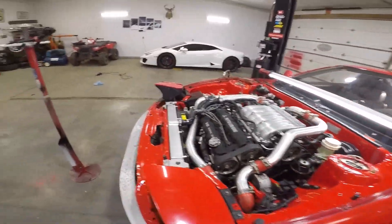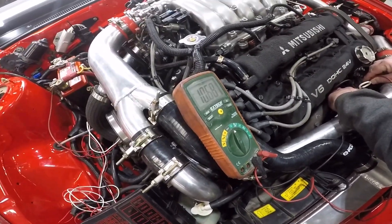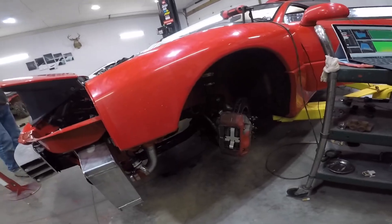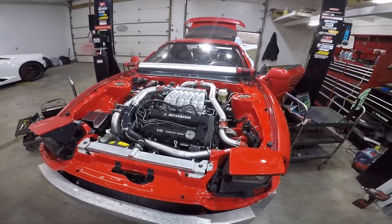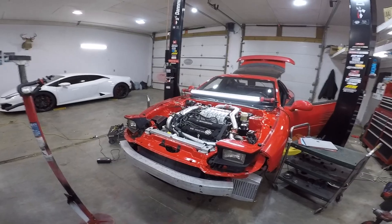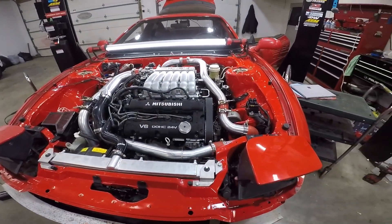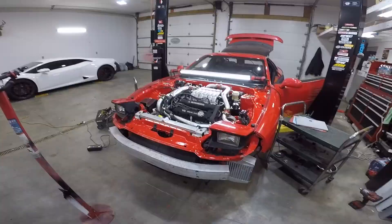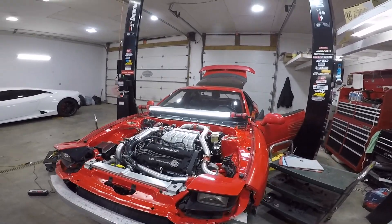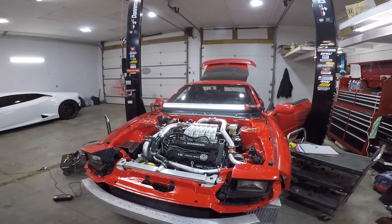Okay, that was not the best start ever but my alternator is not working — it's not charging. I don't want to run this thing too long with no power. It's only putting out 10 or less than 11 volts. Need a new alternator even though it's brand new from Mitsubishi. I'm super excited — it runs, it's not leaking anything anywhere. I have no voltage so I don't want to run it forever like that. She started, she ran. I gotta figure out what's going on with this alternator — it's brand new with not even 30 miles on it. She started right up, super easy, ran great. No leaks anywhere, I'm super pumped. Cams sound sick — leave it down in the comments what you guys think about that lifter tick. I think it's a little too loud; maybe they just need to break in a little bit.